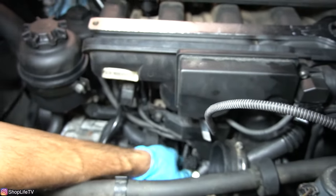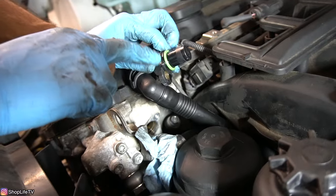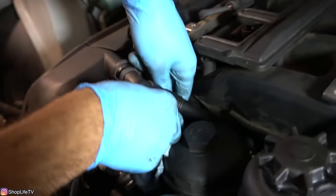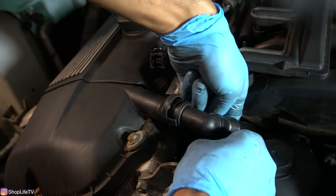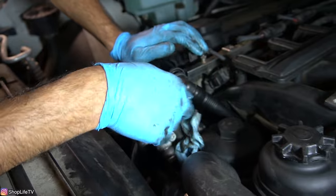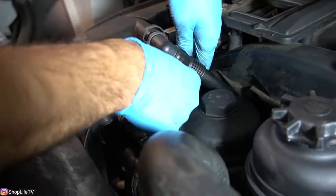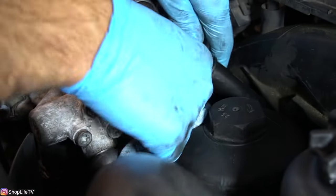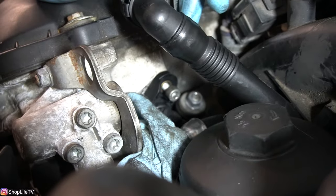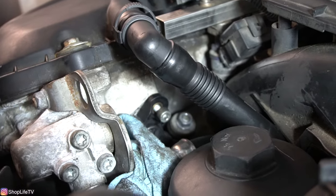Now I'm just going to go ahead and plug it in. I've got oil already on this O-ring, so it's lubed up. We can just push it in place. We're going to push it until it bottoms out against the head, and then you can actually twist it to line up the bolt hole. Make sure that you are threading it in properly — the first few threads should go in by hand, and then it'll start getting tougher once that Loctite comes into play. Tighten that up and then we'll continue on.